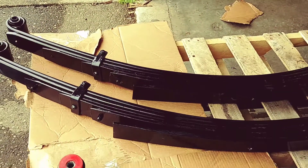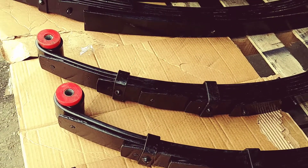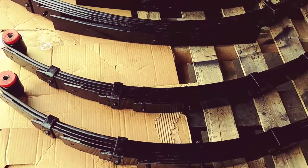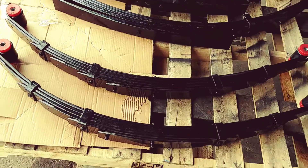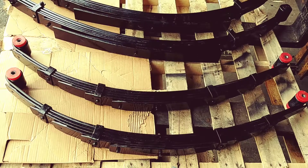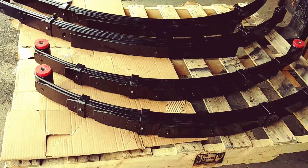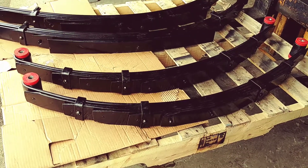This six-inch lift we've done as a five-in-one spring pack. The fronts are here — these are the six-inch with poly bushings. The originals are 22 by 22, so we just customize these springs to a six-inch lift at 22 by 22 inches. The originals were about 44, and that's your custom six-inch front spring for '67 to '68.